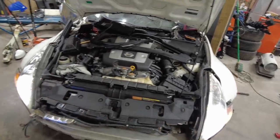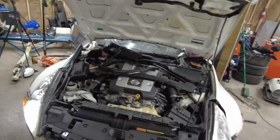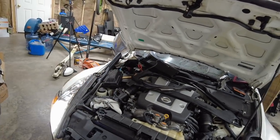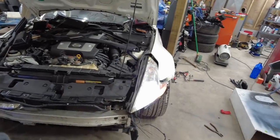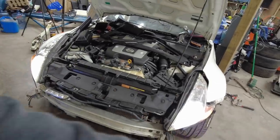I have ground on both sides. I'm just not getting power, and the fuse is fine, and it's not feeding power to the fuse. So my suspicion is the BCM. I'm not replacing the BCM, so being that they only need 12 volts to run, I'm just going to run it into the marker lights or something like that.